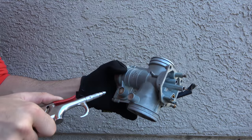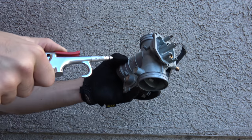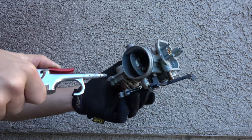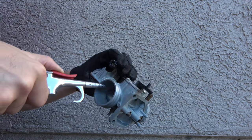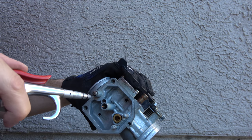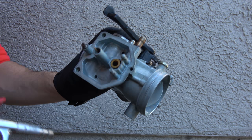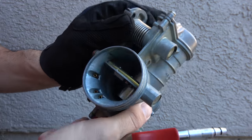The last step in this process is to use an air compressor to completely dry all areas throughout. Also use compressed air to dry your jets. While drying your carburetor, it is best to remove your float bowl for easier access. This process usually takes a few minutes to complete.